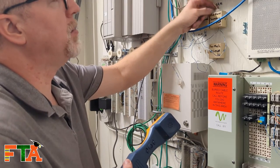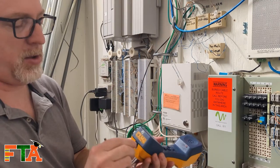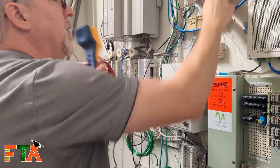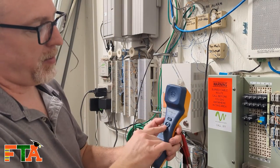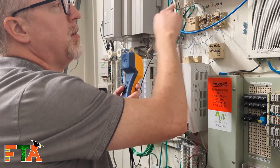You can also unplug the internal wiring, because sometimes you'll run into a situation where it's shorted out or messed up on the other end, and it shorts out here. I have dial tone. So this is last number redial — you just do that and it'll dial the same number again. So we could have something on this cable shorting us out.